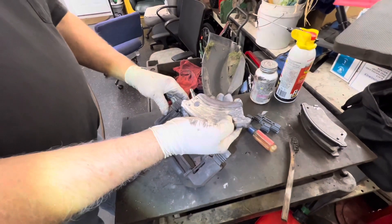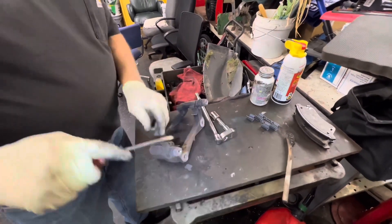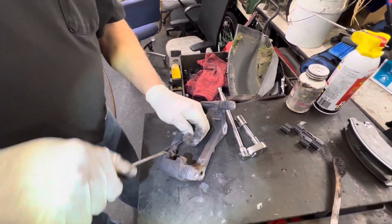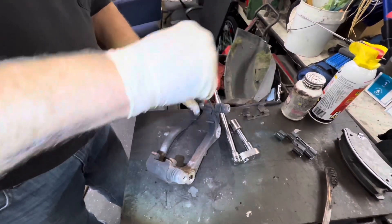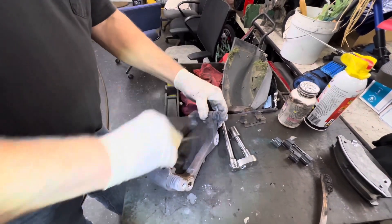This one is down to iron, so that's bad. We're going to remove our clips. The new brake pads we got came with new clips. We got this set from Napa, and the quality seems nice — the clips are nice. We're going to get the two clips off and wire brush these tabs up so that our new brake pads and clips fit in nice and slide down.